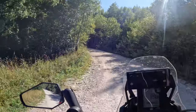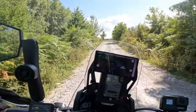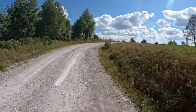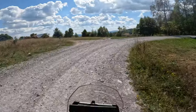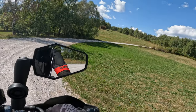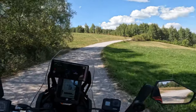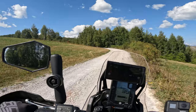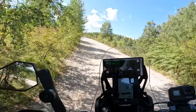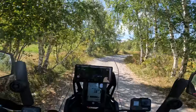Some tires are promoted as off-road tires, and if you don't see it with your naked eye and logic, an off-road tire must have a lot of space between the lugs. An off-road tire must clean itself from mud, from gravel, from everything you will find when you step aside from tarmac. If you're looking for a tarmac tire, you're searching for a tire with a lot of rubber, with no blocks or very small blocks, something which has higher touch base with the tarmac, and that's it.